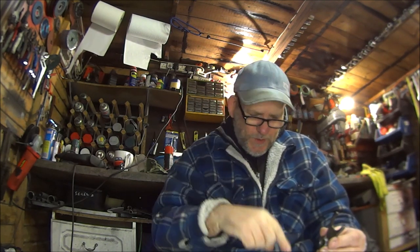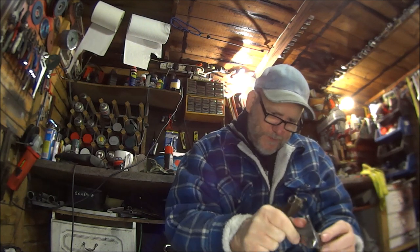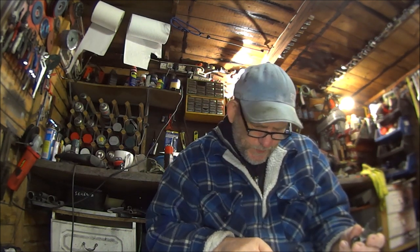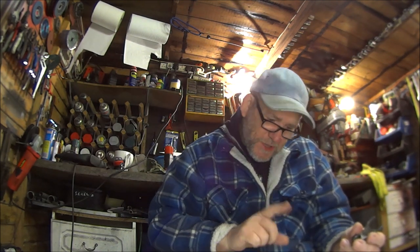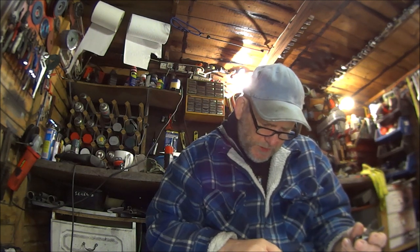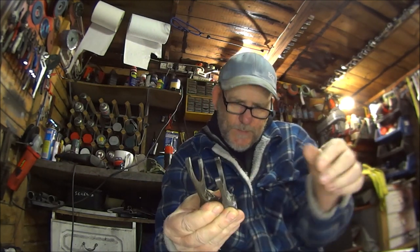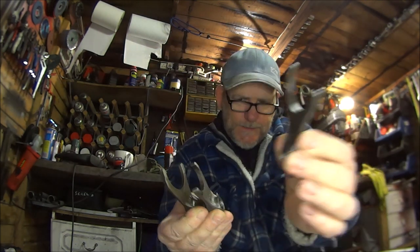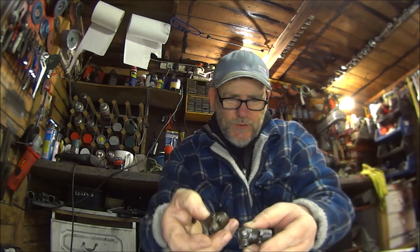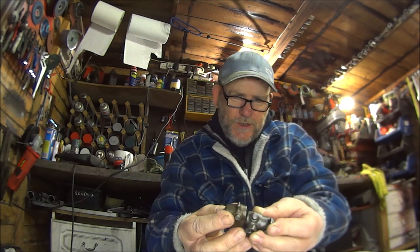But first you've got to install the right side in front of that, because you have to put that on the shaft, and then you have to put that on the shaft. And then it says the left fork is marked with an L and the right fork is marked with an R. Both left and right forks must be installed so that their marks are facing towards the left side of the crankcase, drive sprocket side. So that's got to go that way first, then that's got to go that way first, and then that's got to go that way last. And it just doesn't work out, because you can get those two onto the selector drum, but that one is upside down. So I thought it must be wrong, so I just turned it round and put it in that way.